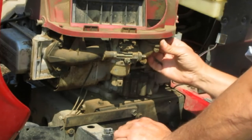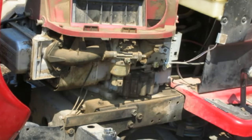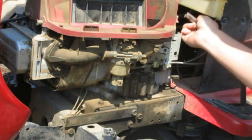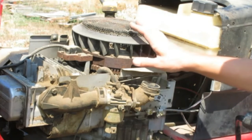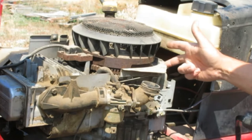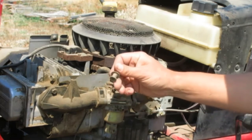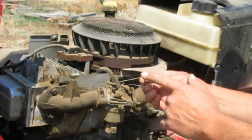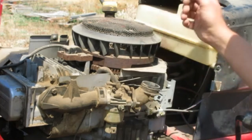Learning experience — I think I might have to take off this plastic housing. I went ahead and took off the engine cover. What's needed for that: there are two 3/8-inch bolts in the back, and up front there are two torx head bolts — these are T45s. Just be prepared, not everybody carries torx heads. There's the exposed engine — still turns nice.